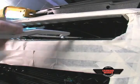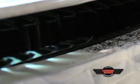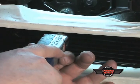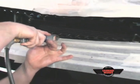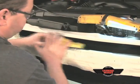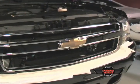Repeat the process of removing the honeycomb from the bottom grill insert as well. The next step is going to be cutting flush to the inside lip of the grill shell. If you have access to an air cutoff saw or a similar tool, it is okay to use this in place of the hacksaw at any time, yet experience with such a tool is necessary. Next, by sanding flush and removing any major burrs from your opening, this ensures that your billet grill will install smoothly. Next, remove all tape from your openings, because this will not be accessible after your billet grill is installed.